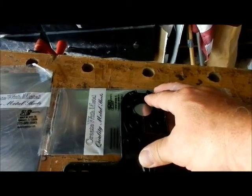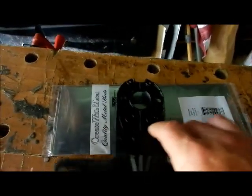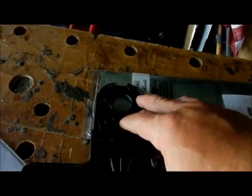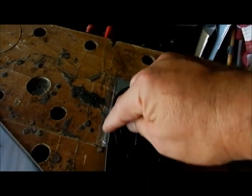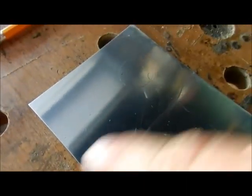I have stainless steel plates — one is going to be up here and the other is going to be down here. I am going to cut the template out. Because this is stainless steel it is going to be hard to do with a Dremel tool, but I will eliminate some of the cutting by going around the edges. The plastic film on it makes it really easy to sketch a line. I put this over it, marked where the center circle is, and where the screws would go we can just drill out.